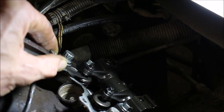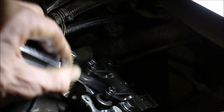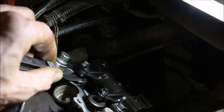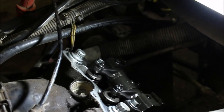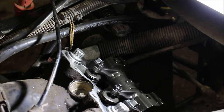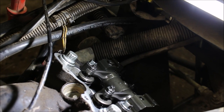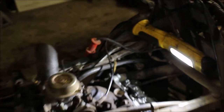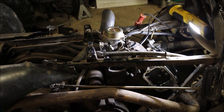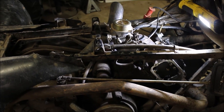As I'm checking the valve clearance at top dead center, I've got a 0.006" feeler gauge and it's not going underneath at all on the intake side — that's pretty tight. The exhaust side is loose. That would explain why it was probably blowing some black smoke, along with the chain slop. When this thing was running I did notice a little chain slop and could hear a rattling noise in the engine — that was my first clue something was going on with the chain.